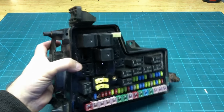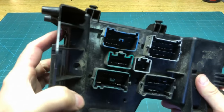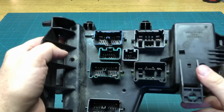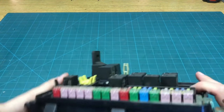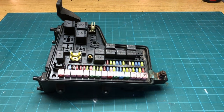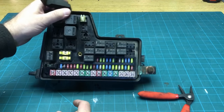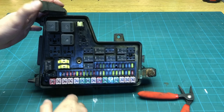We got this thing out of the truck for closer inspection. First thing I noticed is there's definitely some green corrosion kind of oozing out of the bottom side of this thing, and I believe the whole bottom is a circuit board — not looking too promising so far. But the only way to tell is to tear this thing apart and see what's going on. I'm going to go ahead and pull all the fuses out — I already took a picture so I know where everything goes — and all the relays too.